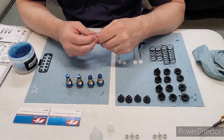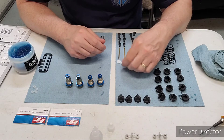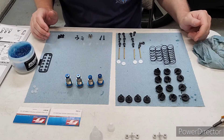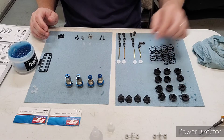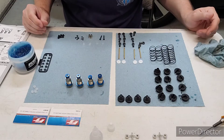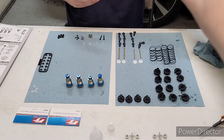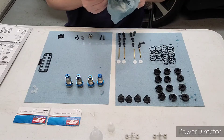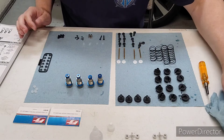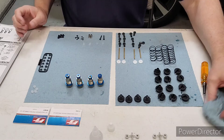The next step is we're going to build the shaft piston assembly. This kit comes stock with 1.6 two-hole and 1.7 two-hole pistons — the 1.6s on front and 1.7s in back. But the team guys have discovered that two-hole pistons don't work very well with the 13mm shocks, and so they've been drilling a third hole in these pistons.